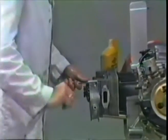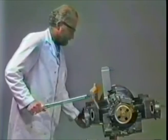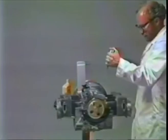I never pull a stud out of a case of a Porsche engine, unlike VWs that pull studs all the time. Porsche case is aluminum, much better, much stronger than the stupid VW magnesium material, except for the new 411 post-1972 buses that VW made out of aluminum. But I find about 25 foot-pounds is about as far as you want to go.